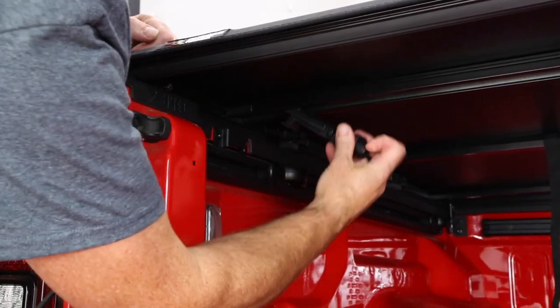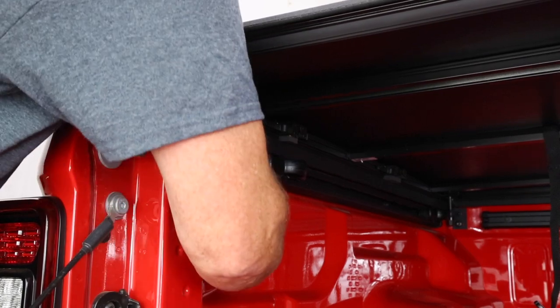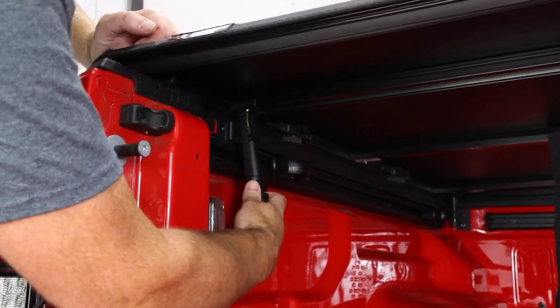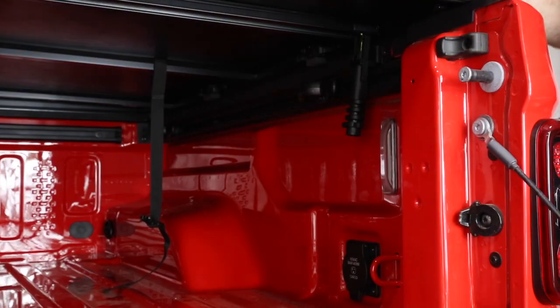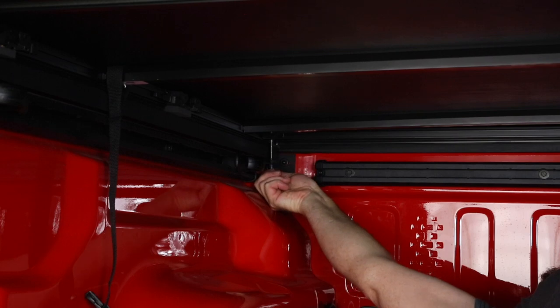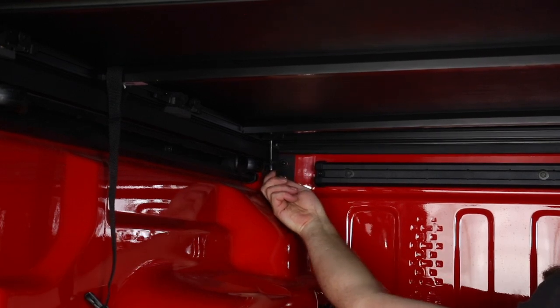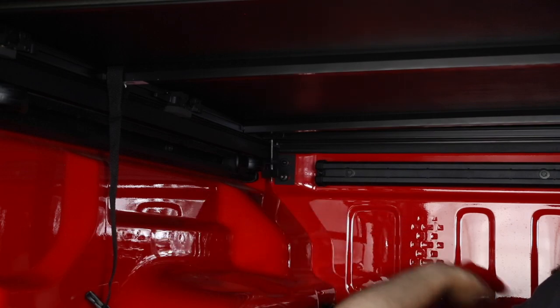Align the top edges of the bed cover so that it is parallel to the bed rails and square. Reach up, fold down the tail clamps, and then pull down and hook into the tail brackets — do that on both sides. Finish tightening down the cover knobs until they stop up against the jam nut. At that point you're done. Don't tighten any further; don't use a wrench or anything like that. They'll be good.